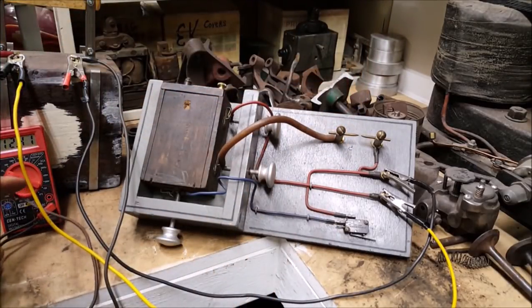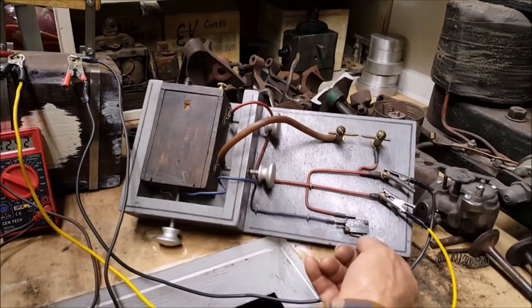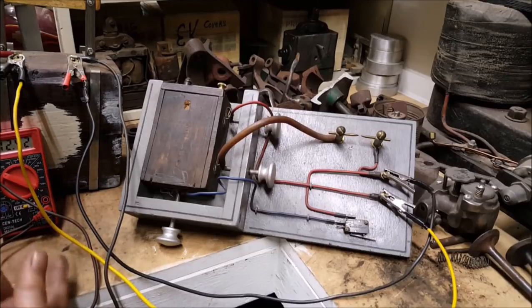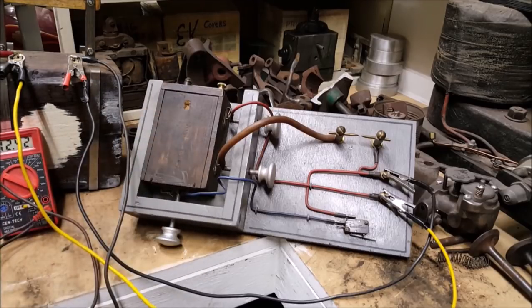You can see I've got the voltmeter hooked up onto the battery up there. When your engine's running and it activates this system, you can see the voltmeter goes berserk, then comes back and finds the battery voltage — it's 12.42 volts on that one. We probably need to know the amps too; that's all important when you're working on your multi-coil setup.